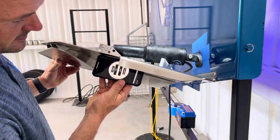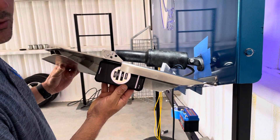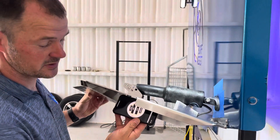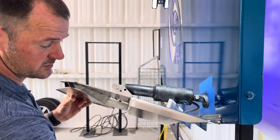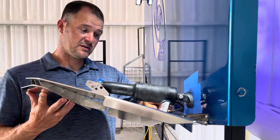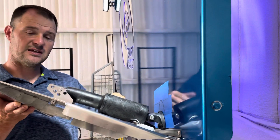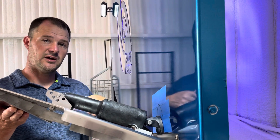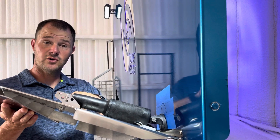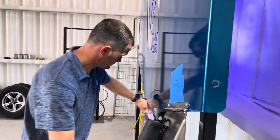I've only got 12 degrees of up angle — that's not enough. I need a minimum of 18, preferably touching the swim platform. To do that, I can move the spacer forward or down to get more up angle, but that won't work because now my upper mounting bracket is touching my hinge. The only other thing I can do is move the lower mounting bracket back.